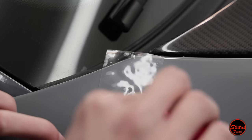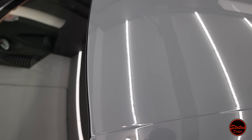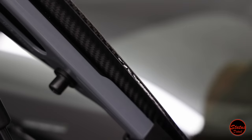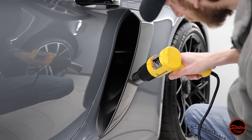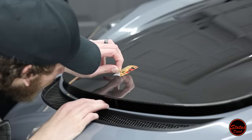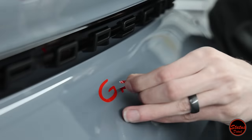After sanding, when I put paint protection film on the car, I can no longer see that defect — paint protection film does a good job of concealing defects, but only to a point. We also had a huge dust nib on the roof that had to be sanded down before film could go over it. There was leftover delivery wrap residue — easy to remove with compound on a microfiber towel. The factory PPF on the vents was also peeling at 40 miles, but that didn't matter since we were removing it anyway. For a proper full-body PPF install, all factory stickers and decals — including the WEISSACH sticker and GT4 RS decals — have to come off, then they're reapplied on top of the PPF at the end so it looks 100% OEM.